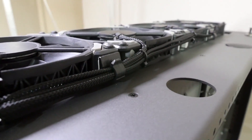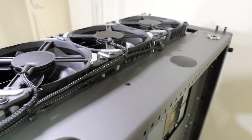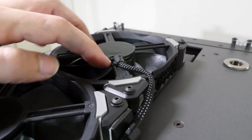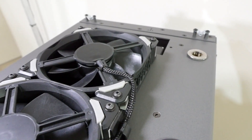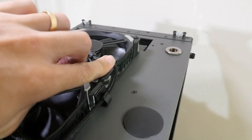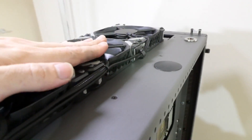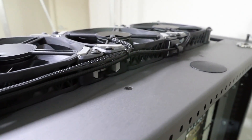Normally I don't need to use these cable management components — these are from ModSmart, I pick them up from Performance PCs, they have an excellent collection. I've only had to use them with these Corsair ML fans because the cable runs in a really weird way. Normally it runs down this section here, but it runs out across an open area — it's just an unusual design. If you just sleeve up to here you can avoid this, because it will be clamped down by the little clip that we've had to cut off to fit the sleeve. Without the cable management components the cables can pop out and sit up a little bit higher, so we want to keep them in position where it's really nice and clean.